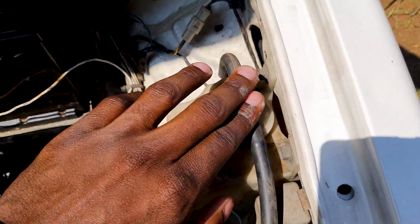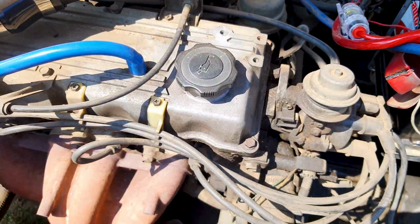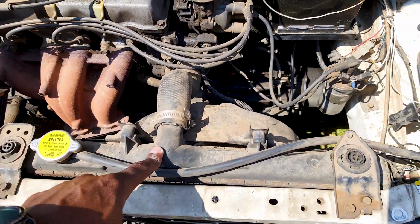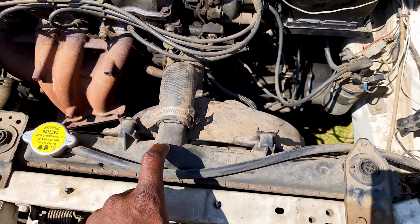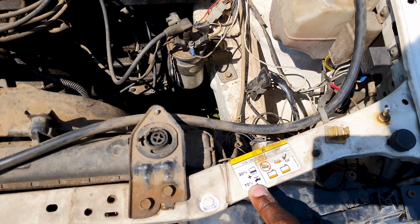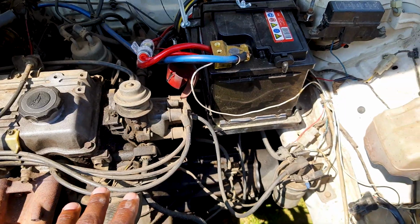So this is part of the process of cleaning the engine and everything. I've already done the service, as you know. So we're going to drain and flush the coolant system and then add new coolant and water. See, this says 30% coolant, 70% water. I've got 10 liters of that. I'll be able to flush the system nicely.